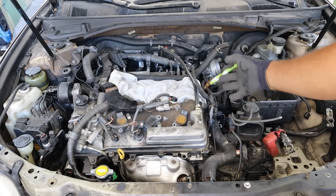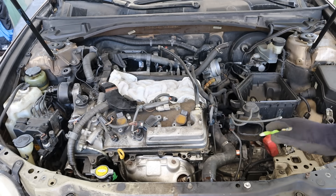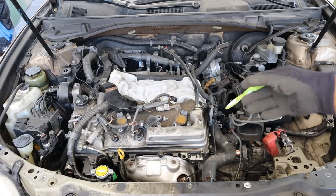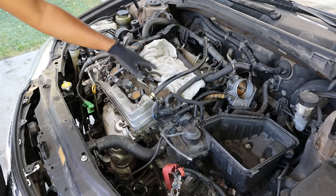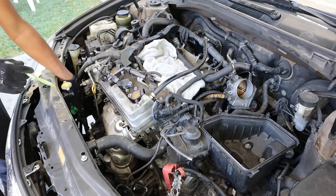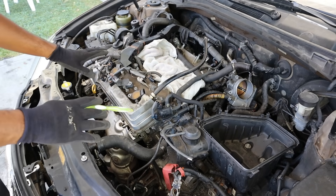The theory is that you could disconnect this engine at the bell housing and just take the engine itself out, without disconnecting the steering rack, subframe, or transmission. Or you could drop the entire assembly out the bottom, but I don't have a hoist. As part of my diagnostics I've already removed the air intake, battery, air intake plenum, alternator, and moved the AC compressor out of the way. But you don't have to do any of that.